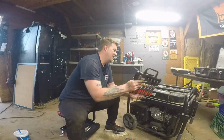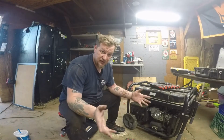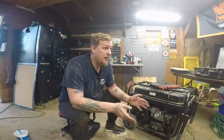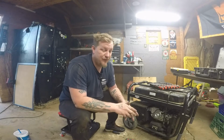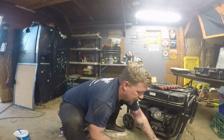But yeah, so I hope this video did help you guys. It's very important because, you know, this happens to a lot of people. But you've seen I got it running again, and that's all it is. It's just a valve adjustment. If you hear backfire, 100% it's the valves normally.